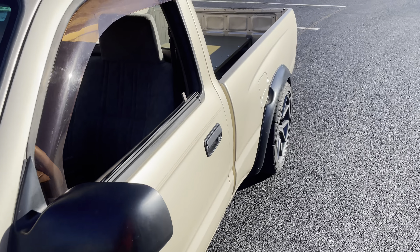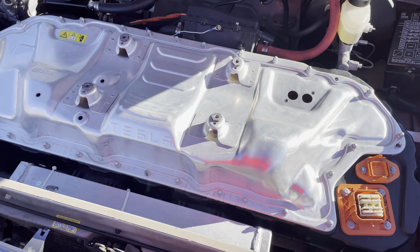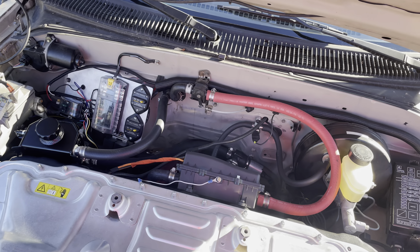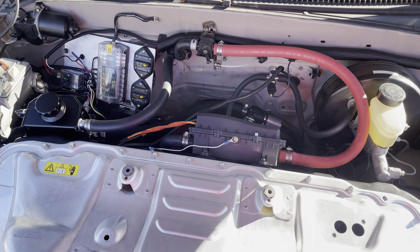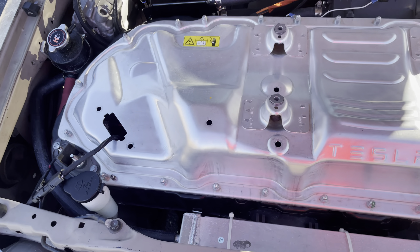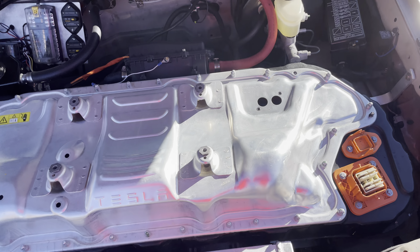Let's check under the hood. Under the hood is pretty much what I'd call the high-voltage side of things — this is the top of the Model 3 battery pack. Inside here I have the contactors for the high voltage, including the contactor for the heater, which is a 400-volt coolant heater. I have a loop going through the heater core, through a reservoir, and back — just a big loop for the heater. Up here is a heat exchanger for the batteries, and there are two water pumps — one feeding the drive unit and one feeding the batteries — to run through the front heat exchanger.